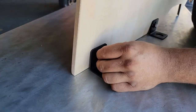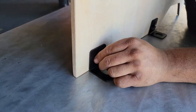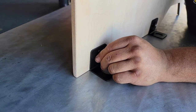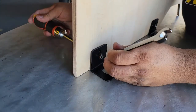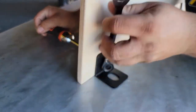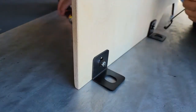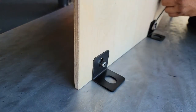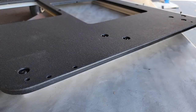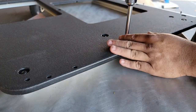These actually pass through and reuse the factory seat mounts in the floor. And if you notice, there's a lot of slot and oversized holes with washers here. This is to account for all the different variations in the floorboard, whether you've added additional padding, have factory rubber floor mats, or actually have the carpeted interior. So keep these loose so that we can make adjustments once we put the panel in the vehicle and on the carpet.